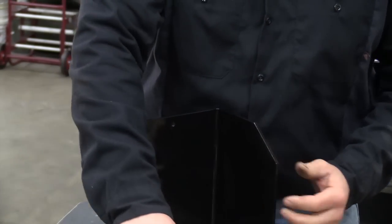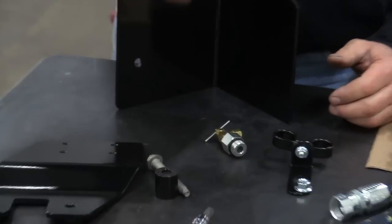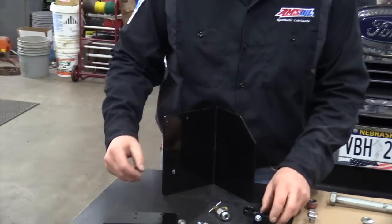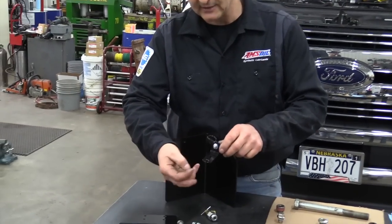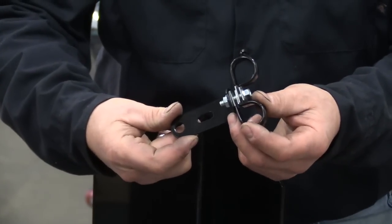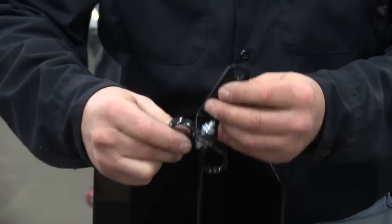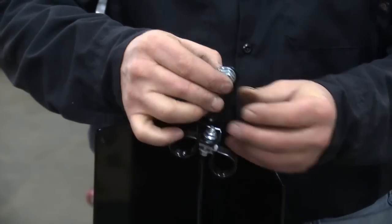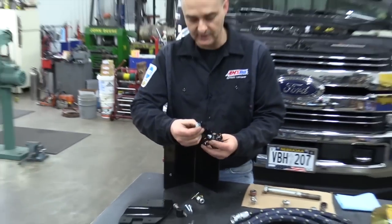There's a spacer, an extra bolt, and mount bolts for the filter head — they're a little bit longer and I'll send those in the kit. There's also a line support bracket that bolts up to the cab mount welded to the frame, and this helps support the lines on the way back to the filter head. There's an existing bolt we'll use to attach that.